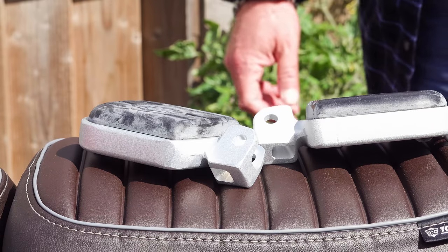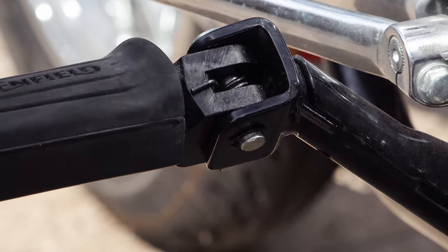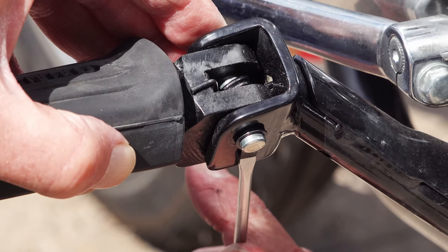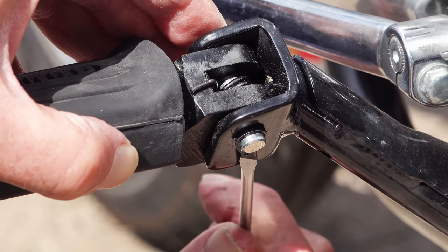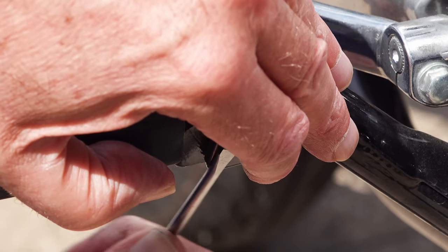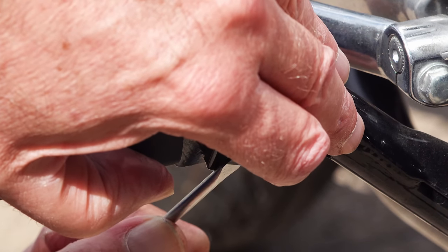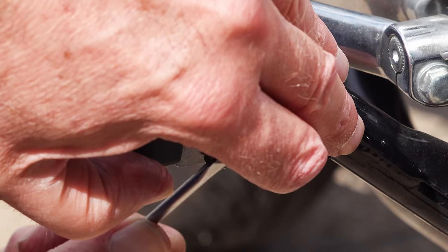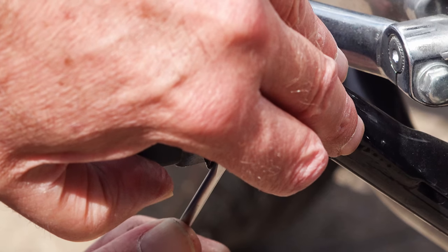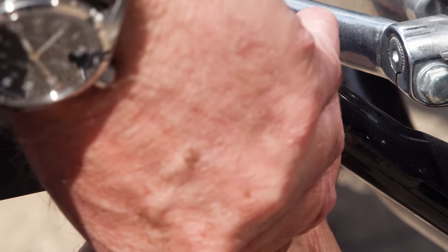The whole assembly is cast aluminium construction — if I had to guess, I'd say these have been sand cast. In isolation they look a little rough and ready, but they're not particularly expensive for what they are. They come with the grub studs pre-installed, but there are no other fasteners or fittings in the box — you reuse everything already on the bike: the clevis pin, the circlip, and the footpeg spring. I'd recommend carrying out this installation on a relatively clean concrete surface — not on gravel, not on grass — because inevitably you will drop that circlip, it's very small, and you won't be able to find it again.